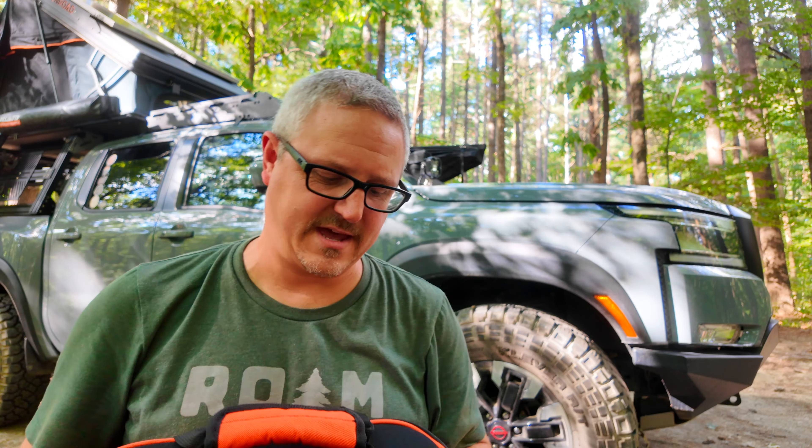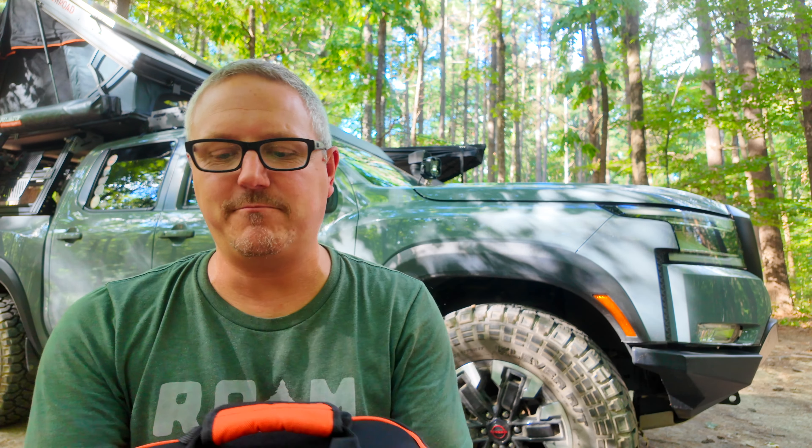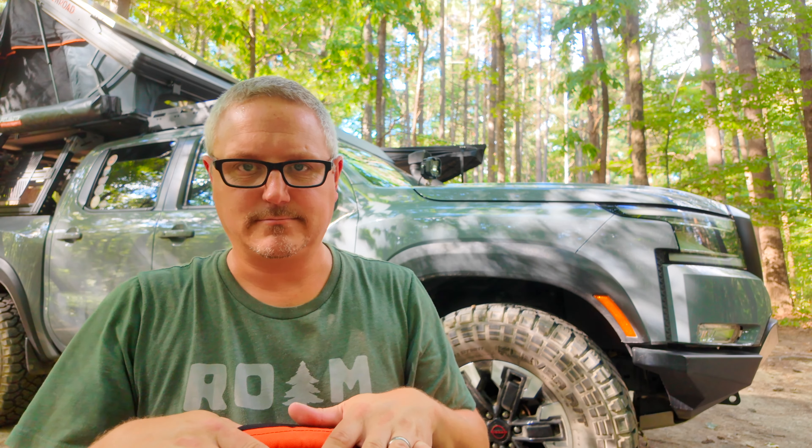All right guys, so there you have it — that was the Eaton Wolf Vortex S6. This thing is really cool. Again, as I've mentioned, if you are a real overlander and a real off-roader, I'm not getting rid of my big dual compressor and my four-tire setup, because a lot of times we air down our tires quite a bit — to 25, 20 pounds, sometimes less if it's snowy, wet, or muddy — and you need a bunch of grunt to air up all four of those tires as quickly as possible. This won't do that. But man, this thing has so many other cool uses.